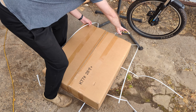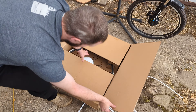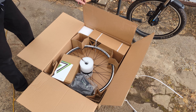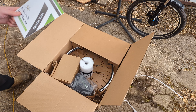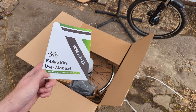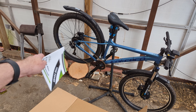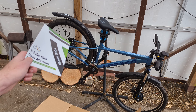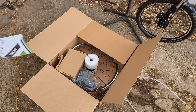Let's see what is in this kit. Hopefully there's a wheel in here — there is! And it's black, which is good. Hopefully that is instructions. On the back wheel you've got two kinds of geary things: one's a cassette and the other's something else. Hopefully I've ordered the right kit to match whatever's on this bike. I just looked on the Halfords website and whatever it said, I opted for the same kit. Because there are two kinds and you need to make sure you order the right kind — otherwise your gears won't fit on the wheel.